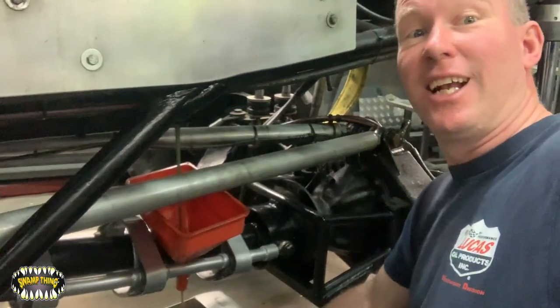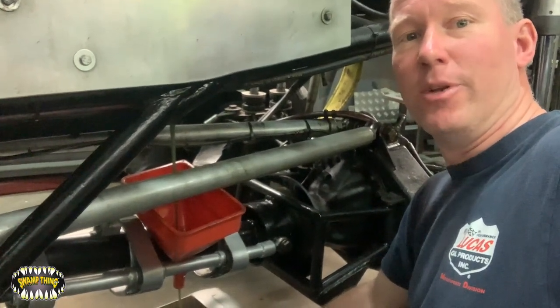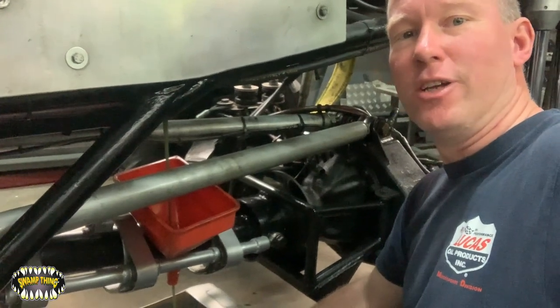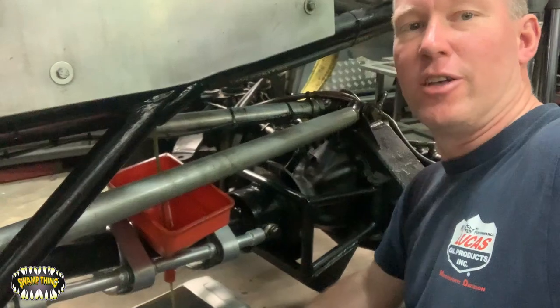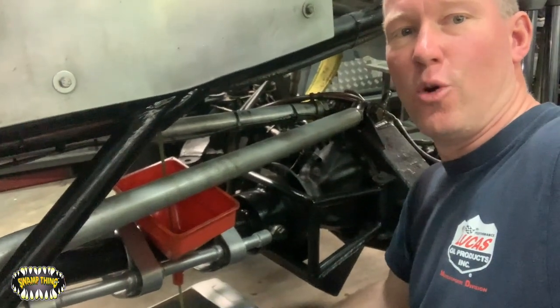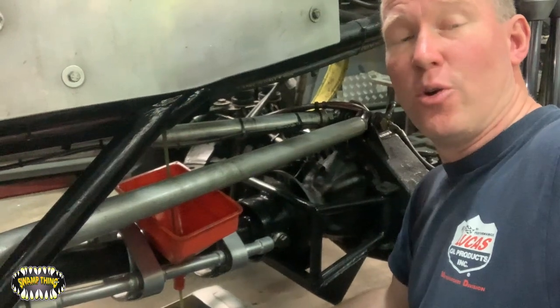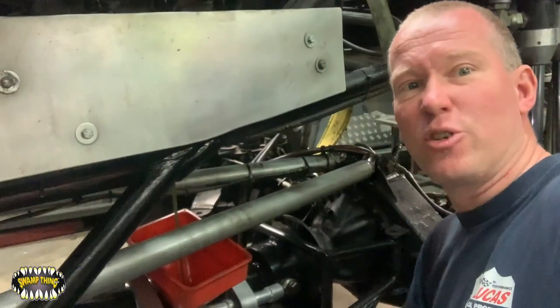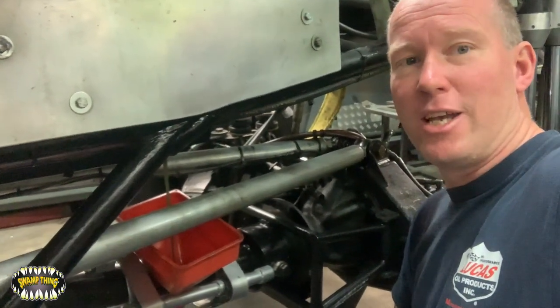As you can see the oil is fairly clean coming out. This engine only has about 20 hours on it at the moment - we normally get about 100 hours before we have to rebuild the engine. You can tell when the engine is getting tired because you actually see more contamination and the oil looks more milky. The oil never goes completely black like a diesel car - there's no carbon because methanol is carbon free.